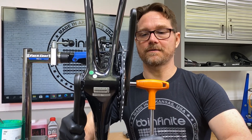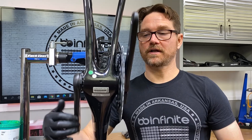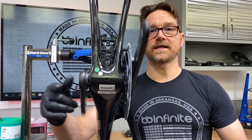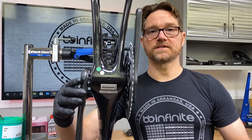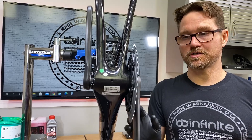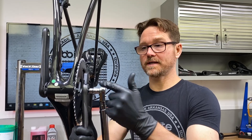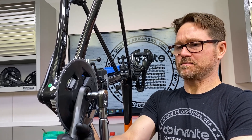As I snug this right here, I'm going to do a final torque in just a second. I always like to spin it intermediately as I'm doing these different steps, just to make sure everything is still functioning as it should be. It's functioning pretty well. I'm going to torque this to the spec that is actually laser etched on the crank fixing bolt itself — it's 54 newton meters in this case, which is about 38 foot pounds. That's a lot of torque.